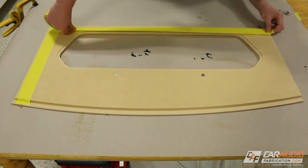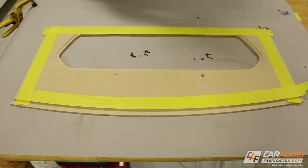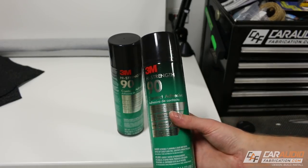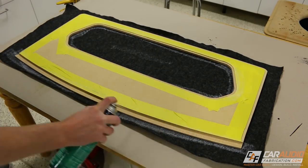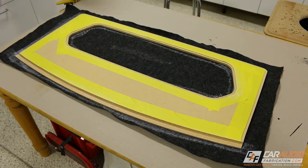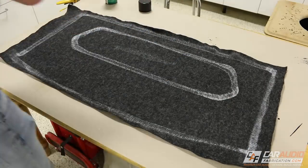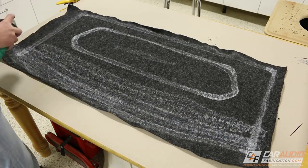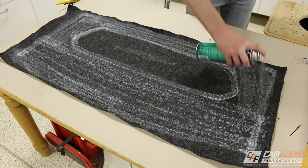Now that I've got that piece wrapped with vinyl, it's a similar process to wrap my other panels with carpet. I do want to point out though, the difference here is I'm using a spray adhesive out of a can. With carpet, the fibers are a lot more exposed and a lot more prone to sticking, so I can get away with just using a spray adhesive like this and get a really good bond. But I would not recommend this style of spray adhesive for vinyl. You really need to use the contact adhesive that I recommended earlier, link down in the description.